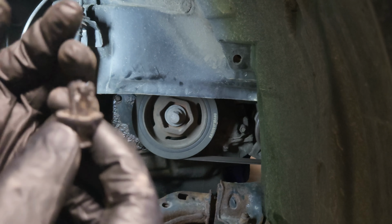Okay guys, the torque for all the bolts, the cover and the actual tensioner is 9 foot-pounds. So it is pretty much tight. So I can actually pull this out and you guys will see it pop up. Let's pull it out from here so you guys can actually see. I think that's pretty much it. It's already got the tension on there, torque everything, and that'll be it. Next, we'll just clean up all this glue here on the sides. Wipe it down, even behind there. And then just cover everything back up.